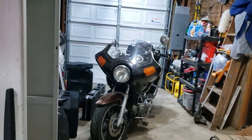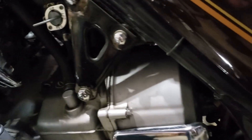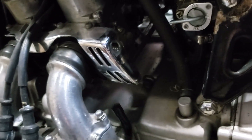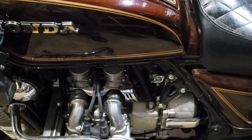Here's another thing I just got last year for my bike. This right here allows you to adjust the low-speed jets right up under your carburetor — makes it really easy to get to. It allows you to individually adjust each carb for a good idle.